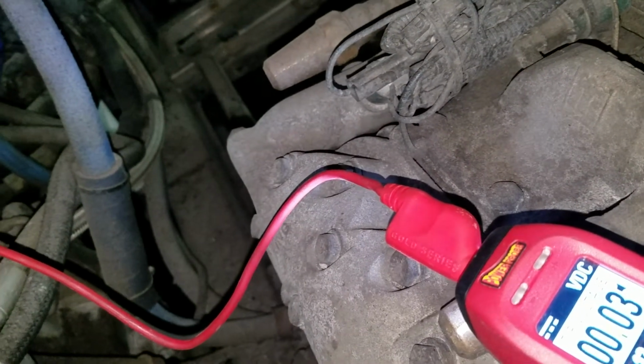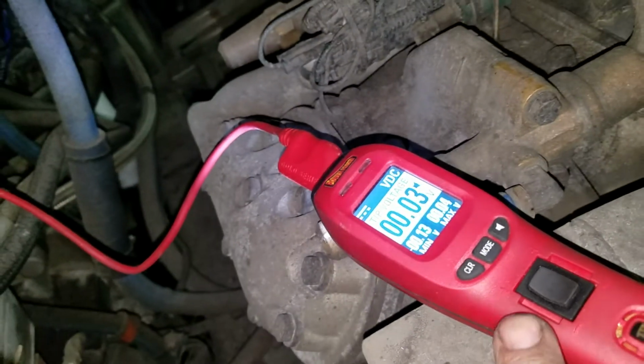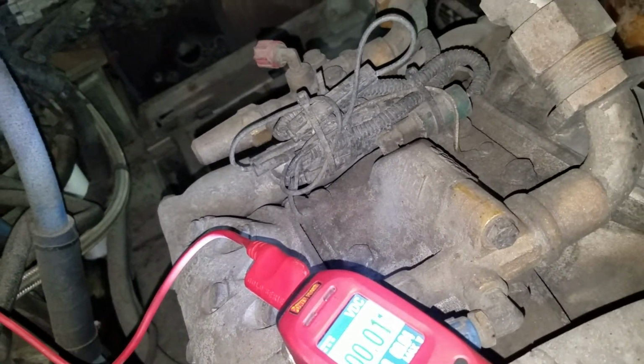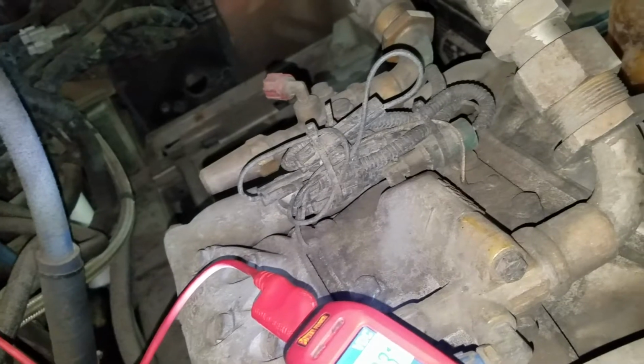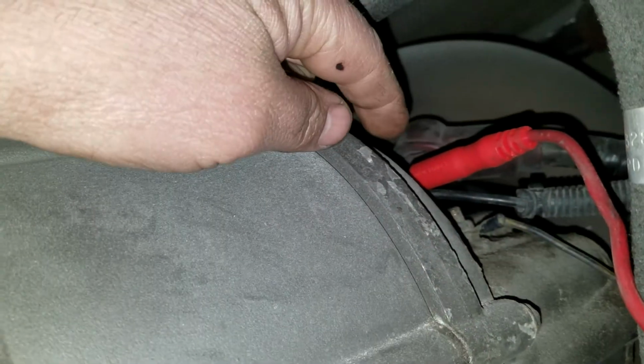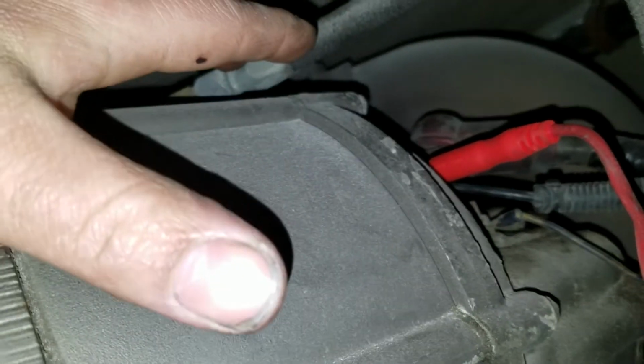That's one way to do it, but what I've got set up here, I'm just using the Power Probe 4 to energize the field windings. It's a positive pulse width fed field, okay? So I just hooked it up here to the field connection at the alternator, okay? And then I started the bus up.